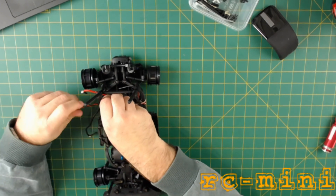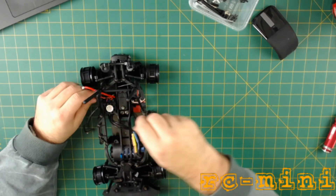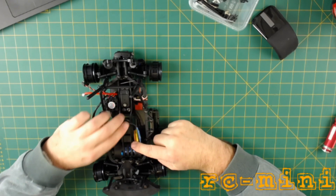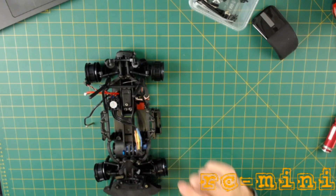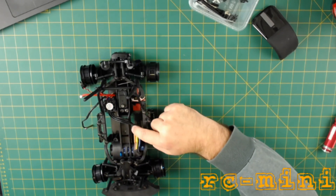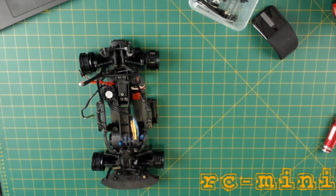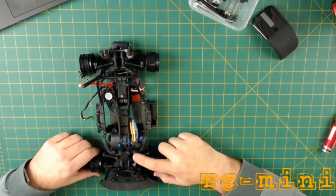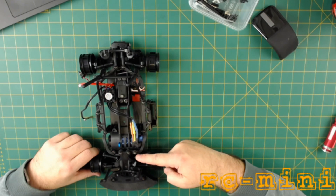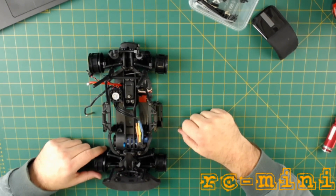The one thing we can't put on tonight because I forgot it when we put the car together is the steering link, sadly. I'll try it just to check clearance later on with an MO5 one, which is a little bit shorter — about five mil maybe a little bit more — because the pickup point on the front is a little bit further forward. So that's most of the electrics in there.